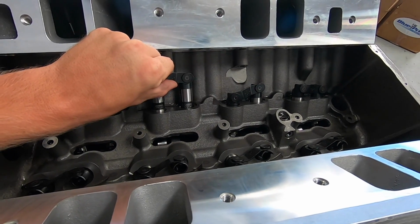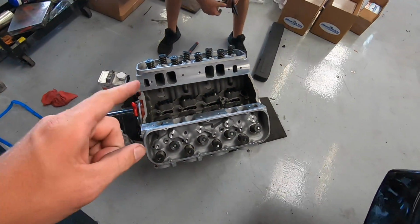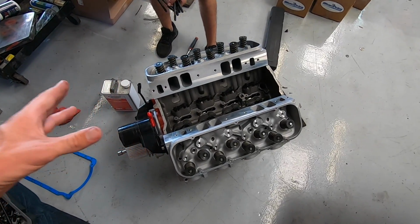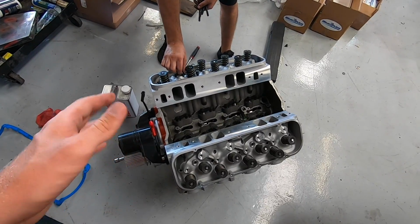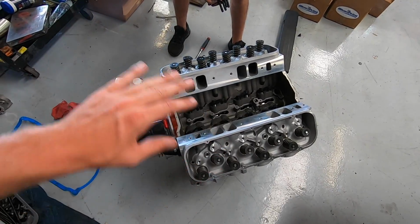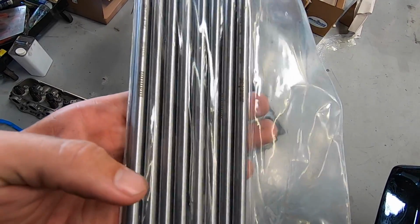Our boys hooked us up, so we got some fresh lifters too for that high RPM rev limiter action. We're also gonna be switching over to a cam sync and a crank trigger to hopefully solve our issue with that false rev limiter thing happening. Just while we have it apart, we're gonna take the due diligence to switch to a new ignition system sensor. So we just wanna try and solve problems before they become a real issue when we're in Australia.